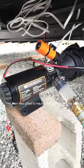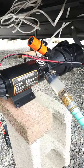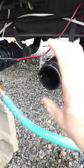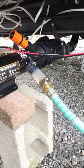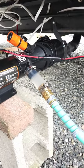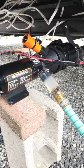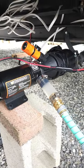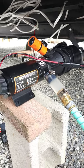Hey friends, this is the macerator pump for RV black water, gray water — whatever. If you don't have close access to a sewer hookup and you don't want to run those big three, three-and-a-half inch pipes with a certain amount of fall all the way to where you need to dump it, this will pump all your stuff right through a regular garden hose. This one shoots it about 150 feet through a garden hose down our sewer line — super convenient. We thought we were gonna have to dig a trench and have a certain amount of fall, all that garbage.